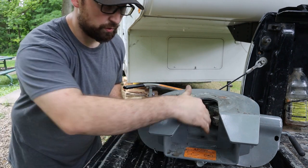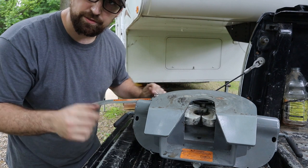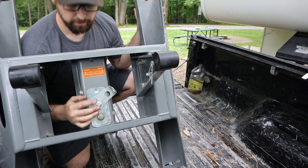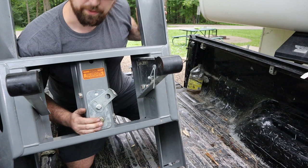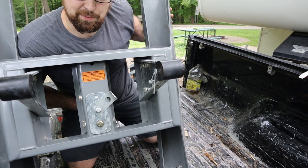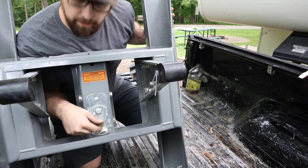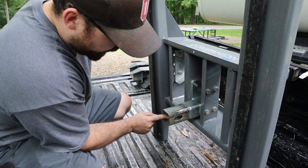You pull in so your pin fits right in here, it'll push against that and actually close by itself. Now if you're unhitching and having a hard time getting it to open — it feels spring-loaded but isn't releasing — you may have your trailer too high or too low with pressure still on the jaws. As far as securing this to your truck, there is a bolt here that goes down through a draw bar through the square attached to the bottom of this hitch. You'll need to let the pin drop into place and then tighten down this draw bar to 60 foot-pounds — that's a critical torque spec, so follow that instruction, otherwise you may have a failure and lose your truck and camper. When done, this little latch fits down over top of it and locks it into place so it doesn't back out.